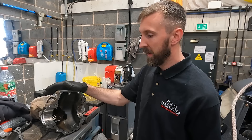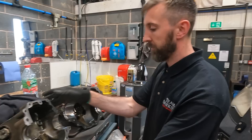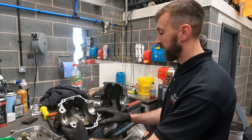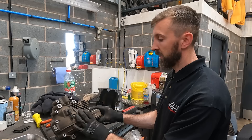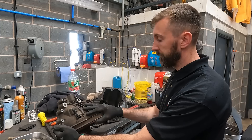There's a massive gap in this video — Danny's annoyed with me because I didn't film what I was doing last night, which was basically installing the e-locker. It was a little bit of a nightmare. The main reason I didn't film it is because setting the backlash — the only easy way to do it is with more conventional diffs that have caps on the housing, making it easier to measure. With this housing the whole casing has to be on before the preload's on the bearings. Because we wanted to get this done in time for Parkwood we've done a little bit of guesstimating. Going forward, we've got a few more of these to do, so I'm going to buy another casing and either cut it or machine the majority of it out so we can build the diffs and properly check the backlash.